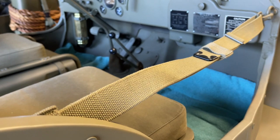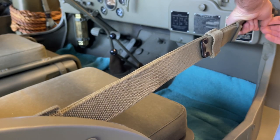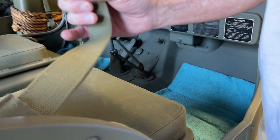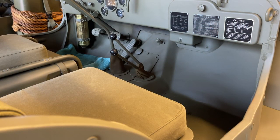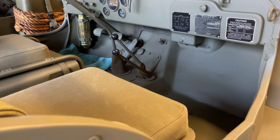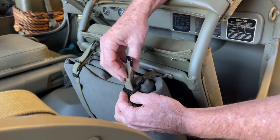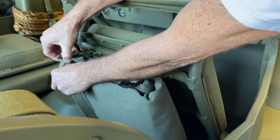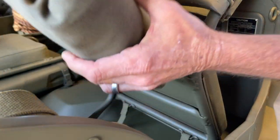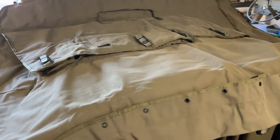The next thing we're going to do is take our top out. I'll remove the doorway strap — just unclip that from the eyelet in the front. These are also made by Joe's Motor Pool and are fantastic quality. I'll flip the passenger seat forward. You'll see those two straps holding that top in there, just buckled through one time. Notice there's one short strap on one side and one long strap on the other — this is an area of great controversy about what would have come from the factory, and we'll be doing a video on that. We'll put those tabs back on and take our soft top out.